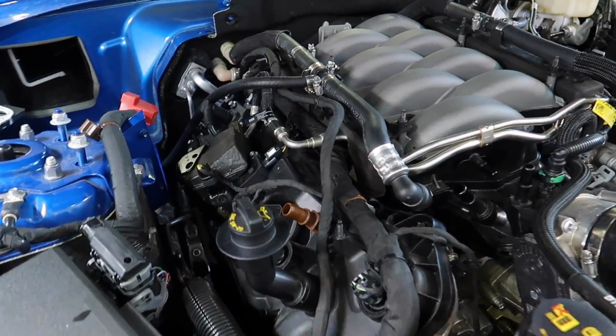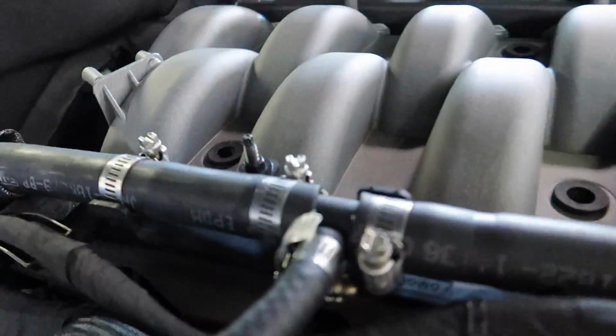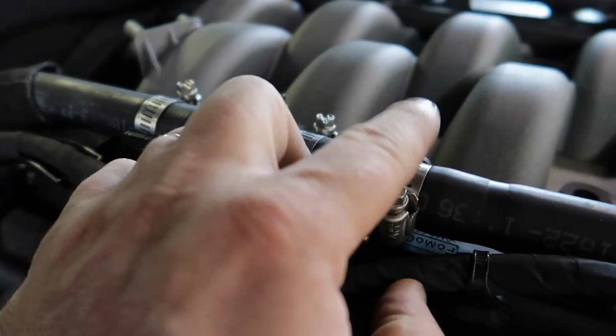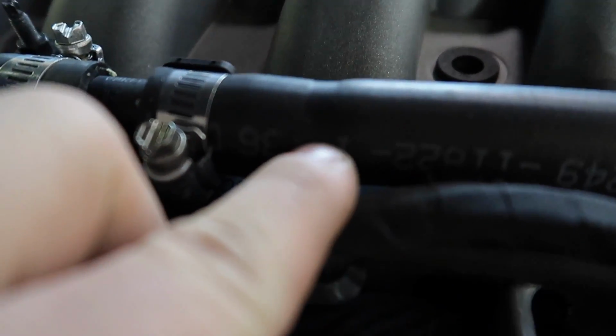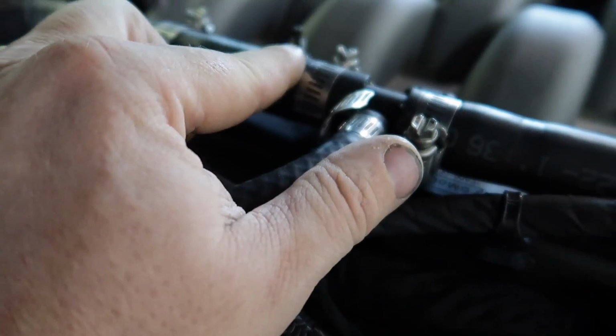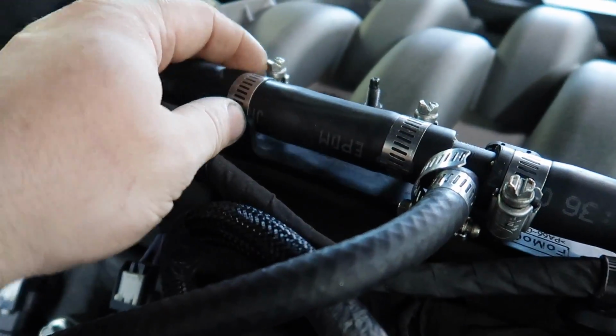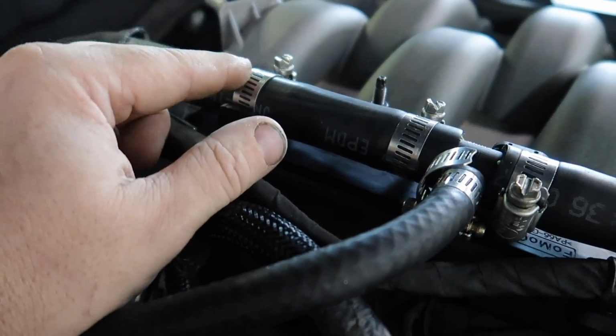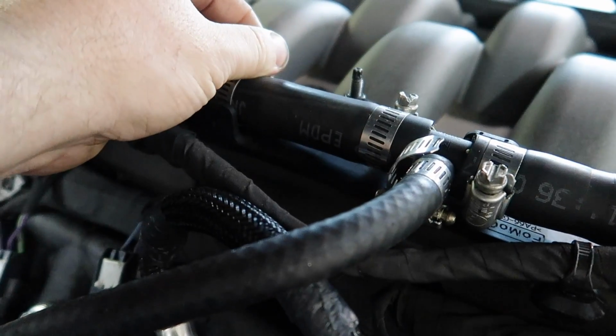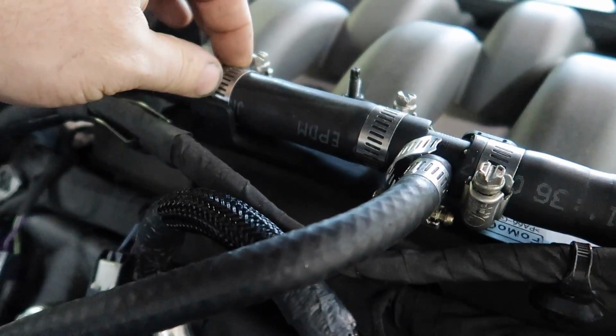So we got the coolant lines run. As you can see, we took that clamp off that was holding the valve that's right here up here. Right there in the ditching. Took that off, cut right here, and moved it down here. We put a clamp back on so it wouldn't get pushed further into this hose as time goes on. You don't have to get it very tight, just enough to hold it right there.